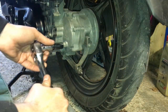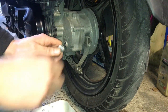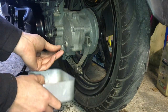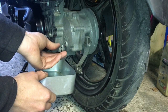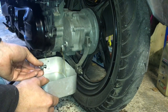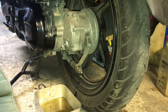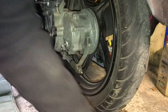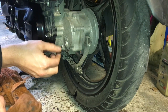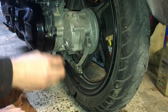I'll do the filler one first — I have pre-loosened these so I know they'll come out. The filler will sit there for a second while I release the drain bolt. When I release this, I'm expecting the gear oil to come out. Well, it didn't really shoot out but it is coming out — I'll let that drain. The old gear oil is all in there now. I've used a towel to clean around the filler cap and the drain plug. Each of these bolts has a little washer, so make sure you've definitely got one washer on either one.